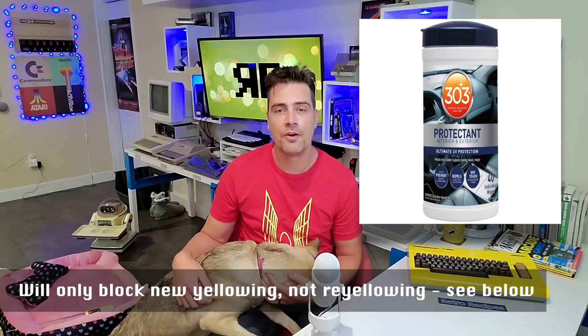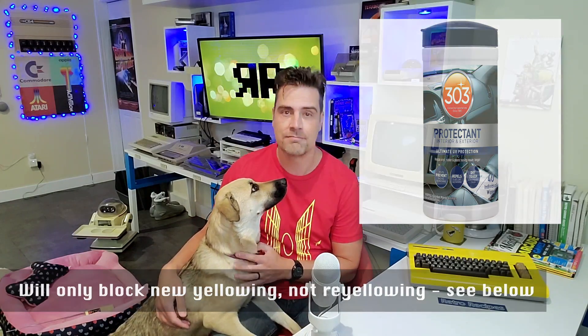Once I have the bleaching where I want it, I'm also going to use these UV-blocking wipes on the plastic as a kind of sunscreen for computers. For every downside there is a light-bright side: it doesn't cause brittleness as fast as the traditional retro-brighting method might. Hydrogen peroxide is likely to penetrate into any undetectable cracks in the plastic, and Dr. Pickett says that would be very bad for brittleness. So there it is - light brighting. Test it out and let me know how you get on in the comments below. Remember, as with any technique, there are no guarantees it will work the same for you due to the multitude of different environmental factors both in what caused your yellowing and this method of fixing it.